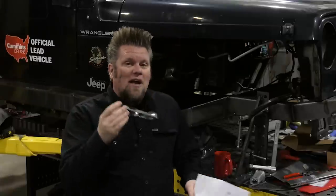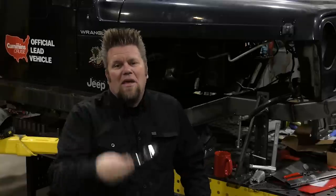A lot revolves around personal preference — there are benefits and drawbacks to both. I myself prefer an automatic mainly because I build a lot of them and I'm more comfortable with them. That's why you see a lot more automatics off-road. The technology in transmissions like the Turbo 400 and the 4L80 — the strength you can add to those transmissions is unparalleled. You can build a bombproof Turbo 400 that will get you home no matter what. That's what's in trophy trucks and Ultra Four cars. To me, that's almost the perfect off-road drivetrain.